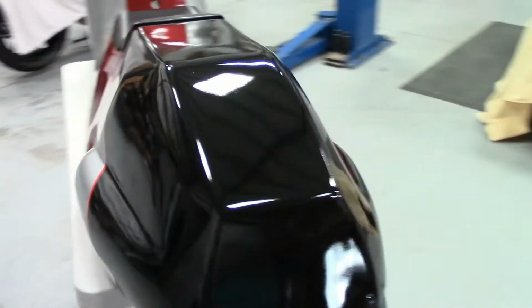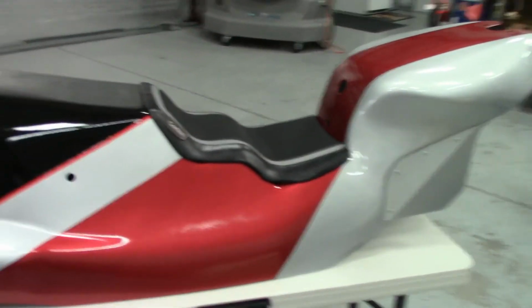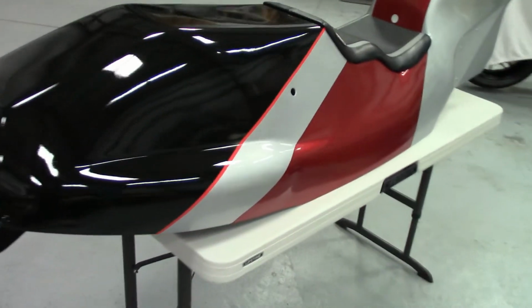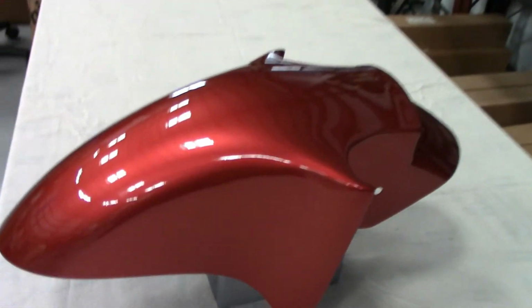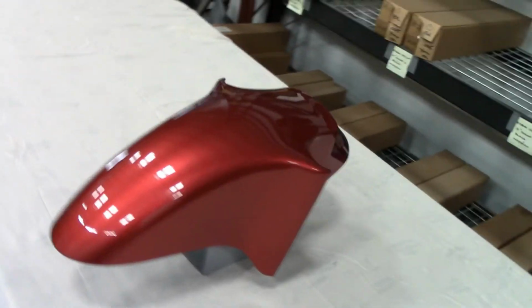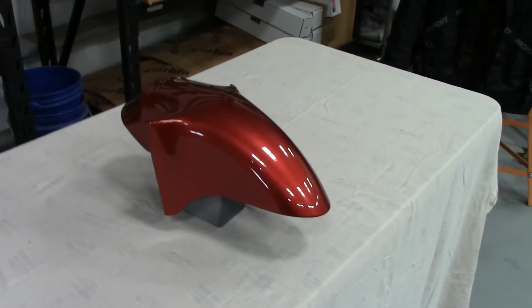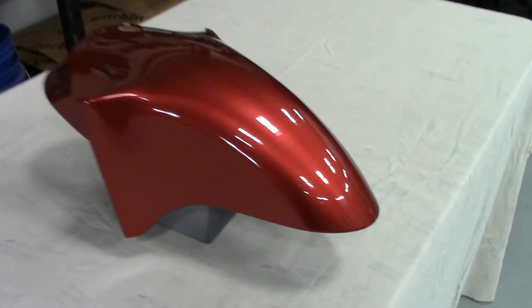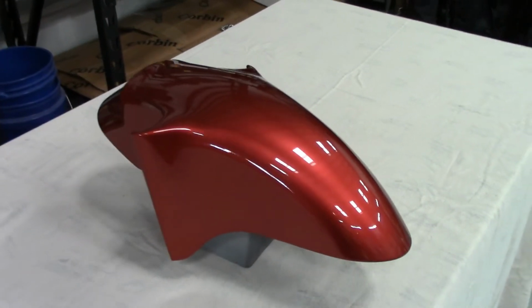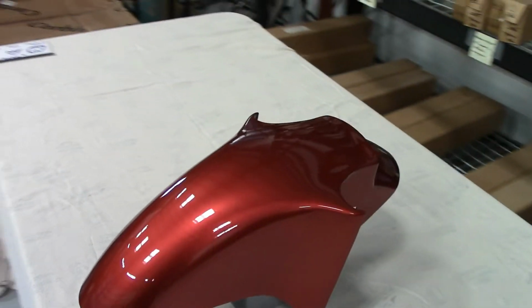And it has some crap in it because we got all the fires from California and the Sierras going on up here, but still did the best I could with what I had here, basically in my shop. On the other side, I just changed the fender from black to this. The Spray Max 2K Clear will do one full go around the body, one full pass, and a pretty decent coat. Well, that right there, my friends, is one full can on that fender. Again, that's the Ford Electric Current Red.